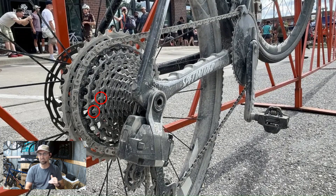I'm very interested to see if it still has the kind of slow shifting that T-type has. The reason it shifts slowly is it has to make sure the chain is locking into each tooth as it goes through the gears. If it shifted super fast while you're mashing 800 watts, it would mess up and break some teeth off. This shifts a little slower to make sure it locks into the next gear so you're not skipping across the cassette and breaking teeth.